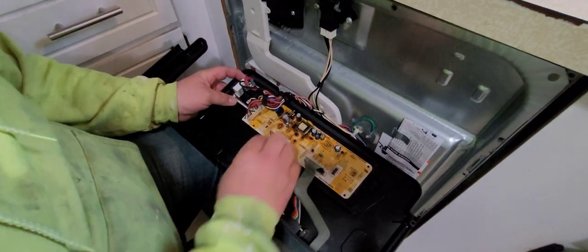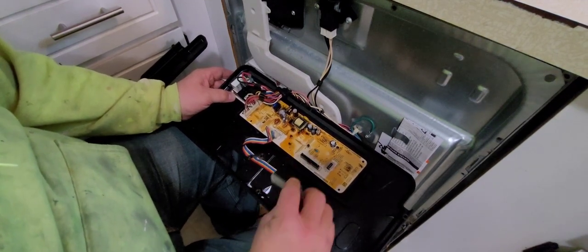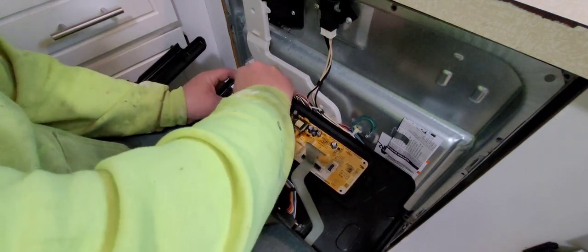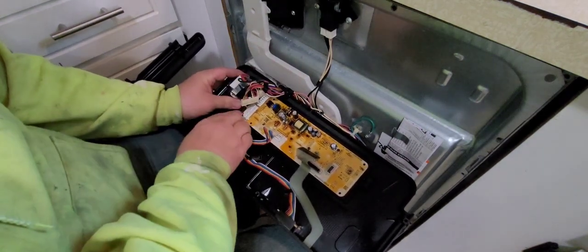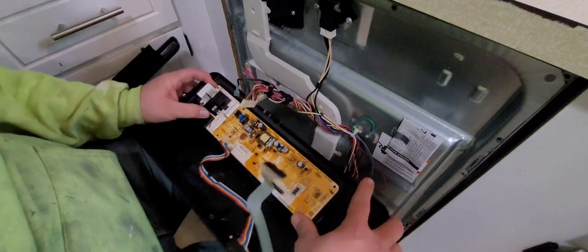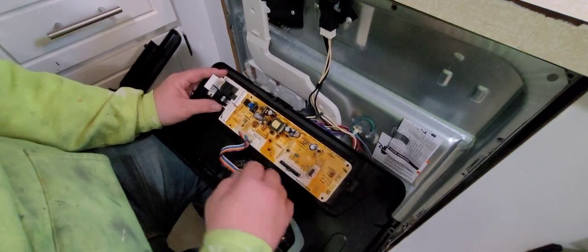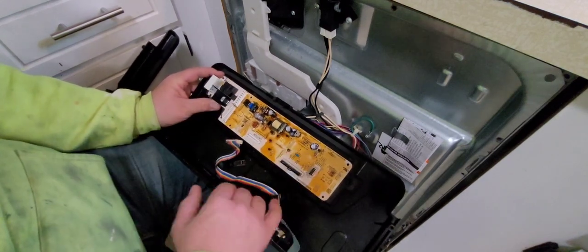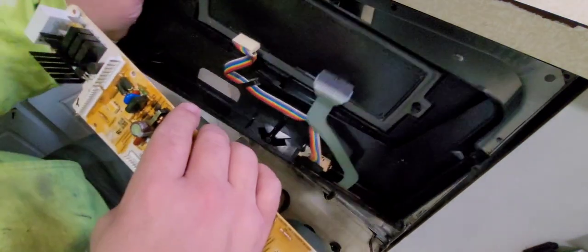This is what it's going to look like when you open it up. This ribbon cable just pulls out, this one just pulls out, this one just pulls out, this one pulls out, and then you've got these two connections over here that pull out as well. Once you've got that loose, you're going to have the assembly free from the machine. Then there are a couple of Phillips screws around the sides — no big deal. Unscrew those and take the circuit board loose from the panel.